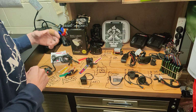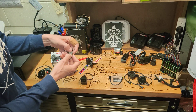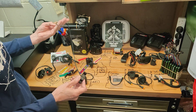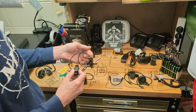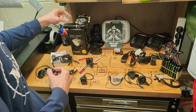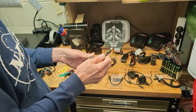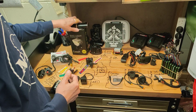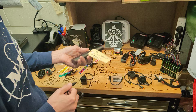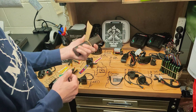The Turbo Torch ones actually have, similar to this, an external remote button, but rather than being USB-C, which has waterproofing and water ingress issues, it actually works on the DC connectors. So that's these type of plugs, but actually waterproof ones that seal up and go onto the external battery. So that's about an 8 or 12,000 milliampere hour, 7.2 volt external battery.